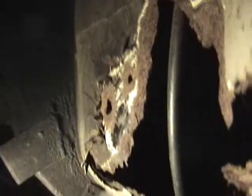The car's floor is actually, as far as I can tell, really solid from underneath, so I'm not too worried about that. I just have to get all this patched up here. What I'm doing right now is I scraped away everything from inside the car. Now I'm trying to get the undercoating away from the bottom of the car here.